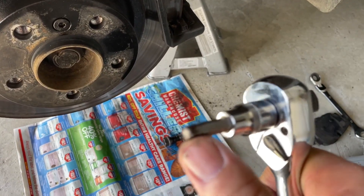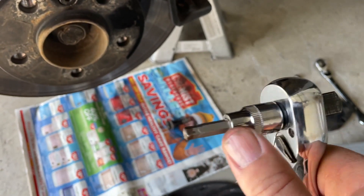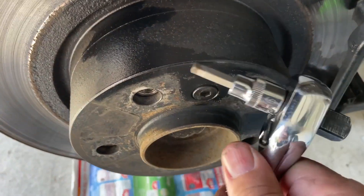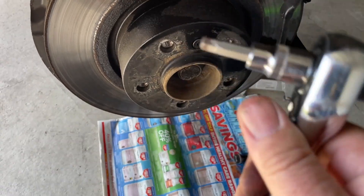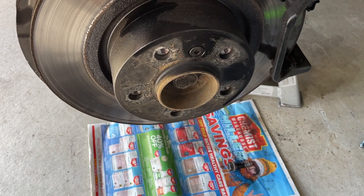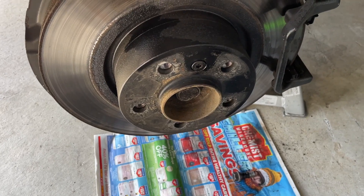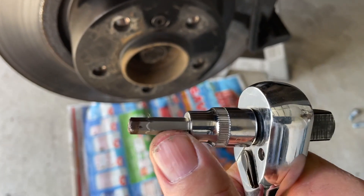Get something like this — this is an allen key mounted into a socket. I'll put links to these in the description. Don't muck around thinking you're going to get out with a hand allen key — these are buggers. I've had to chisel them out, I've had all sorts of problems. Get a socket like this and then use an impact wrench on it to get it out, and certainly soak it in WD-40 or CRC overnight. This is a pretty new car — obviously the older the car the more they stick. Get something decent like this; I'll have linked to a set — absolutely brilliant to have for when you get stuck.